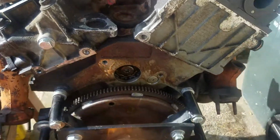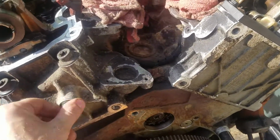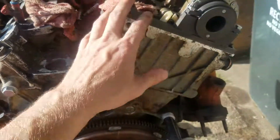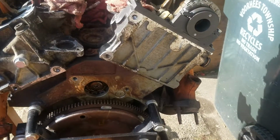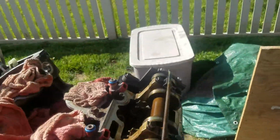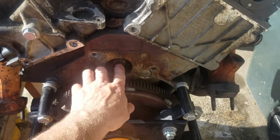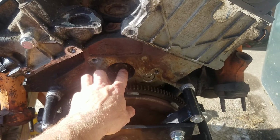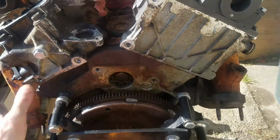So if you do replace a hardware fastener on your engine, you want grade 8 or grade 10. More often you want grade 10, because it's not just cast iron. It's got a higher carbon content. They're actually tempered bolts. Some of these they're done weird. Like this one, the torque-to-yield bolt, have to replace this one because you torque it to stretch that thing, and then that's it.